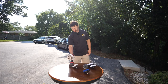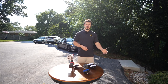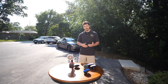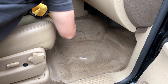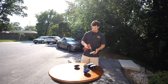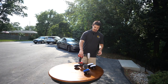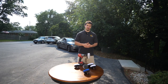When I first started with my drill brushes, I was literally addicted to them — I'd use them on everything. So of course I tried them on the interior. And they work well, but there are some things that are a little bit annoying about it. For example, when you're on the driver's side and you're trying to get that carpeted area below, you're going to often hit walls. This is really with any interior area — you're going to hit the plastics on the sides. Honestly, the drill brush isn't going to damage any of the plastic, but it's just hard to maneuver in and around properly because the size of the drill is quite large compared to a hand brush. You have a hard time getting into those smaller areas. There is a little bit of nuance to using a drill brush for interior work because of just the space requirements.